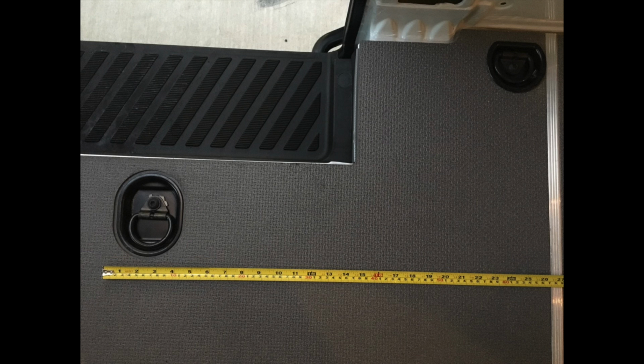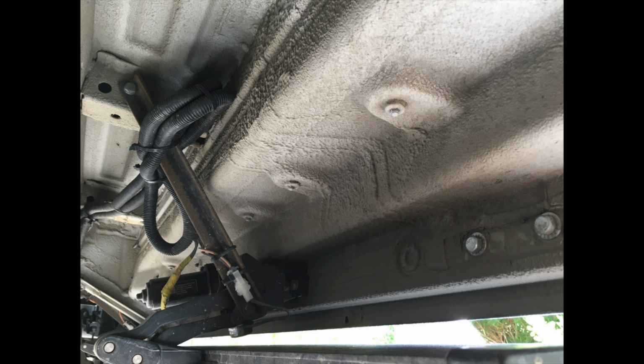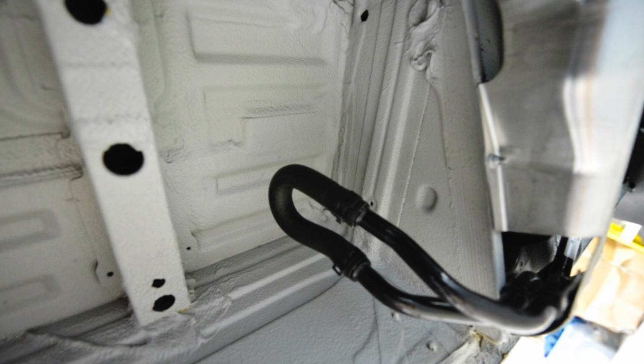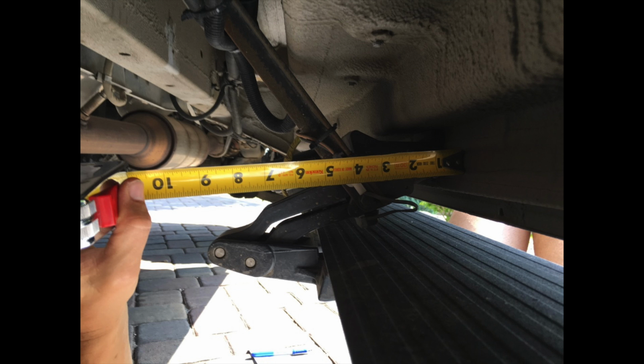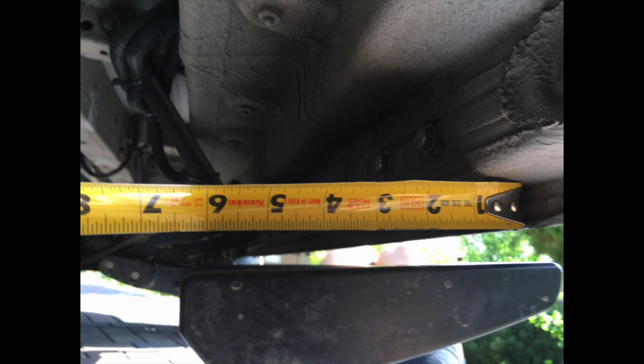They are very difficult to do through the floor because the bottom of your floor does not look the same as the top of your floor. And so you will have to be very careful with the way you do dimensions and measure things out, and really check that multiple times to make sure you got it right. In my Sprinter van, and also in a Dodge ProMaster and a Ford Transit that I've helped others do work on, drilling through the floor was challenging because, like I said, not everything lines up. So really do check that in many ways.